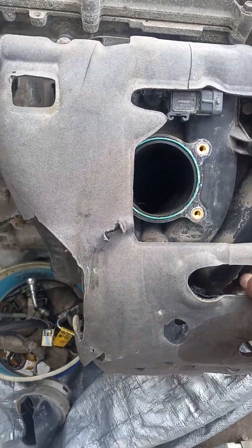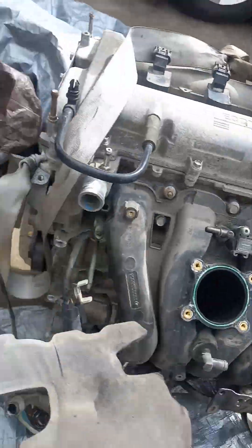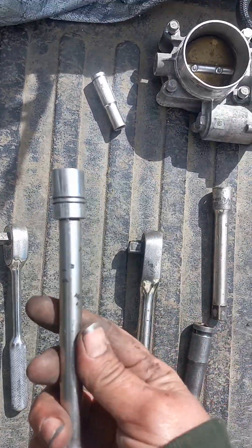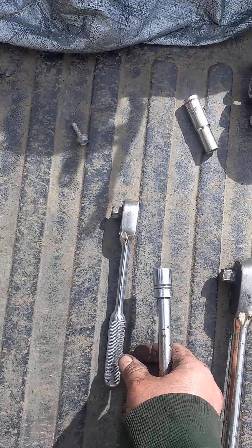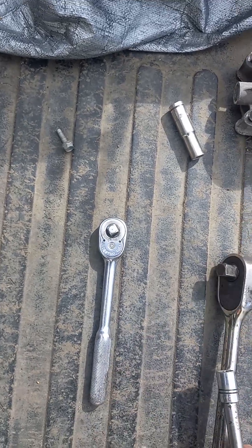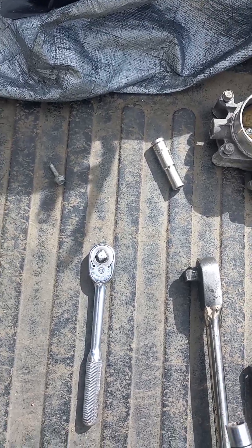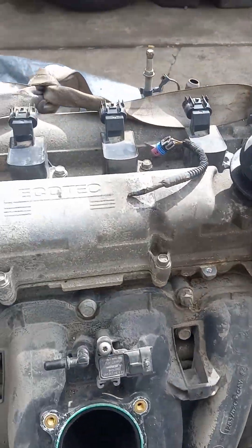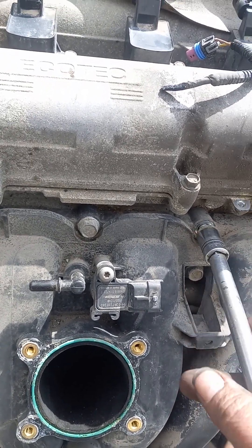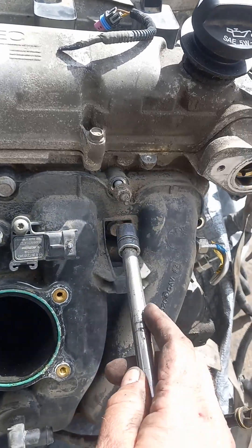Alright, I got this off without any rips and tears. You just gotta guide it out real good, make sure you don't get it caught on anything — that's the insulation. Now I'm gonna use the half, 13mm 3/8 drive. In my last video I said I'd explain this — for people who don't know, the little around mid-size I call it is 3/8s, and then you got a half drive, it's way bigger. You can use this to loosen some stuff, but torquing it down sometimes you don't want to do it too tight. Loosened all these — here's the other one, two, three, four, five bolts — all loosened for the intake.